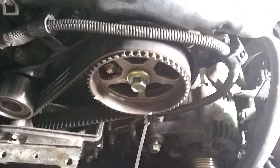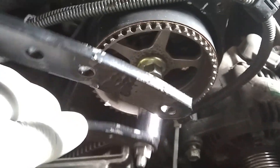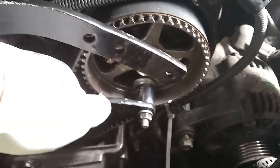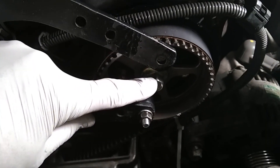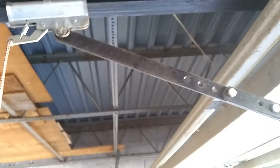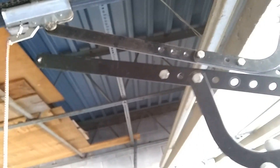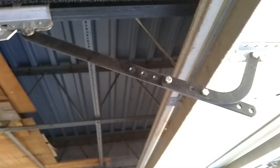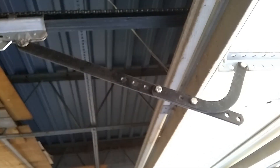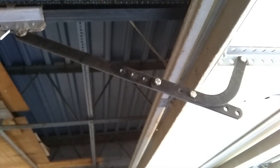This is the timing belt pulley. Imagine that we have both sides prepared like that, and I can squeeze that in here. The washer will prevent it from slipping as I tighten this bolt right here — a 17mm bolt — and the torque here is pretty high. This is the piece of hardware from the garage opener that I used. You might be able to get this as a scrap part from people who work on garages, or you may just save one from an old garage opener. It worked like a charm for me.